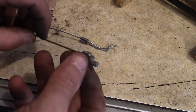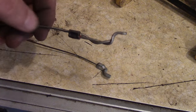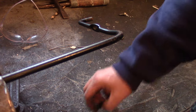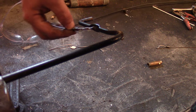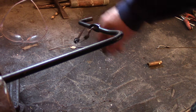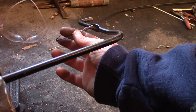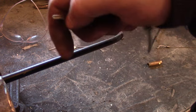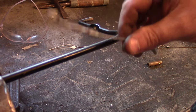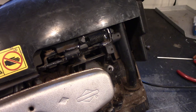Here's what we're shooting for — this is the one that we made, and you can see it looks really nice and it's real solid. I have the lawnmower handle up where you can see, and all you do is take your end, feed it through the hole, and it should go down this way, basically just like that. You just need to make sure you measure your cable so it's the right size. If you need to fold up your handlebars it'll pop right out. This stuff is real strong — it's pretty thick aluminum and when you double it up like that, that's how you do it.